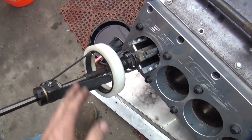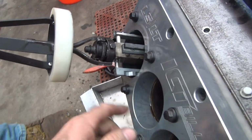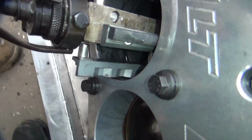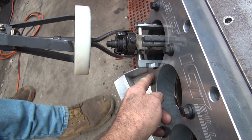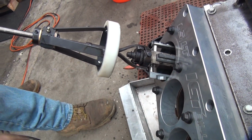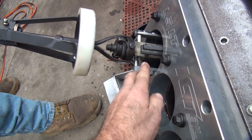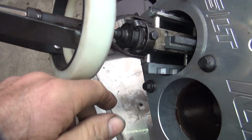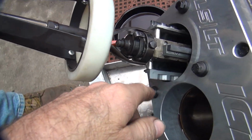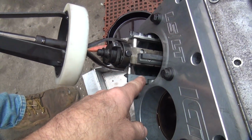Okay, hold on, don't take it off. You want the stones to come about halfway out of the bore, maximum. So you're more than halfway out right now, so no more than 1 inch out the top of this plate. Okay. I wasn't coming up high enough. Half an inch is fine. Just don't go more than 1 inch. It'll pop out like I did before. Was I taking it out that far? I'm not sure, but I'm just saying don't come out further than that. Yeah, you're too far out already.